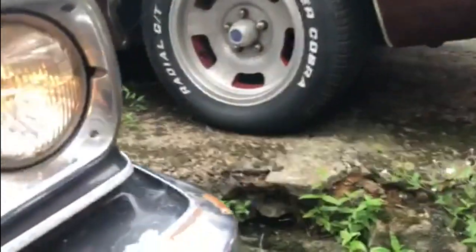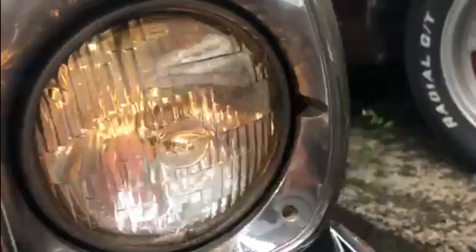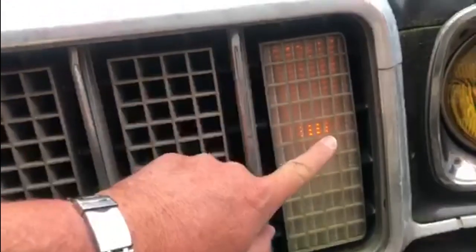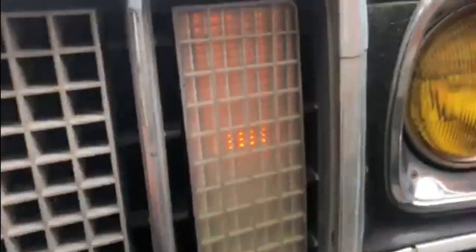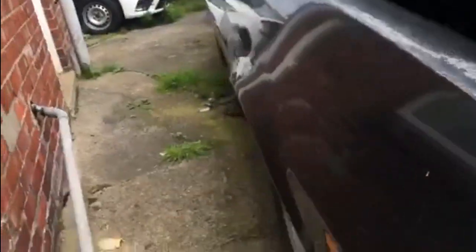This car is slightly different in as much as we've got a side light bulb in the headlight — you can see that one's on at the minute. We've also got a side light bulb in there, and that is the full length of the radiator grille — that's the side light marker that's on. This unit is also the indicator, and on the side we've also got side markers. This particular side marker is lit up, however if you go around to the side of the truck you can see that side marker's not working — that side light's working, but that one's not.